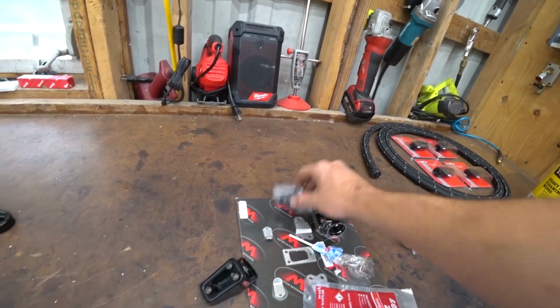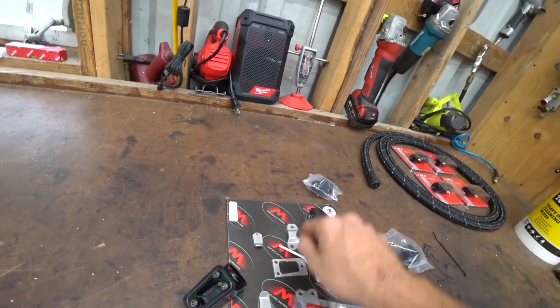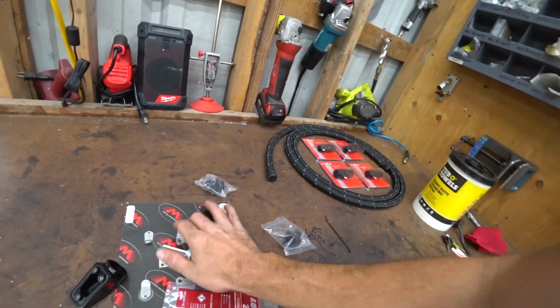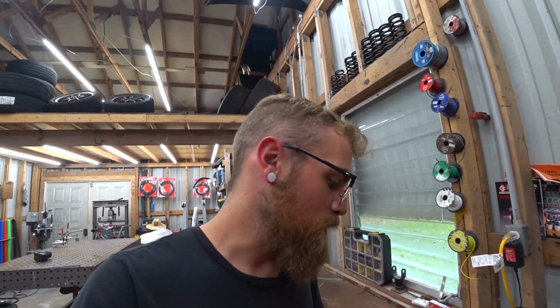So this is our template. And then they have this baffle, which goes in here, and then this, which kind of goes over top and is our inside bracket. So they are really, really well baffled, which is crucial if you have fittings on a valve cover and they're just an open hole. Oil will just splash out, and you will fill catch cans. Most of the time, if you're pushing a lot of oil into the catch can, it's just poorly baffled crankcase ventilation. So I'm jibber jabbering on.